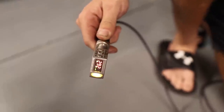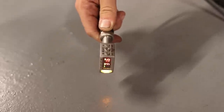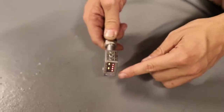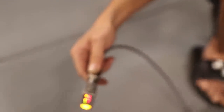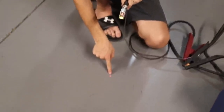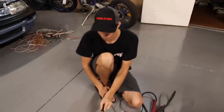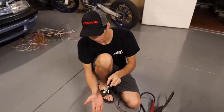The sensor's range is from one inch to 20 inches from the ground — you can see the indicator light on the front turn off when it goes out of range. The readout is in millimeters and reacts in real time incredibly fast. You can see the laser dot projecting on the ground. That will tie into the FuelTech computer to give real-time, very accurate laser height data for wheelie control. That is freaking sick.